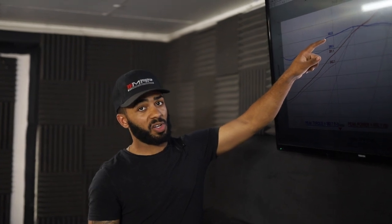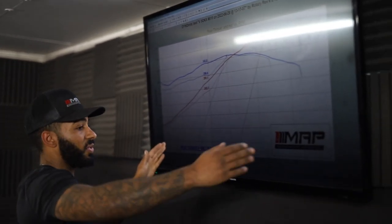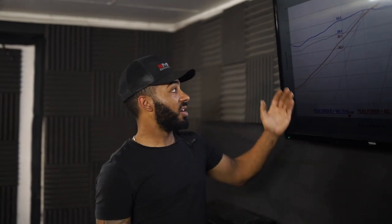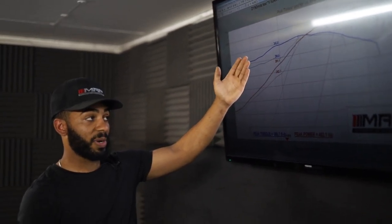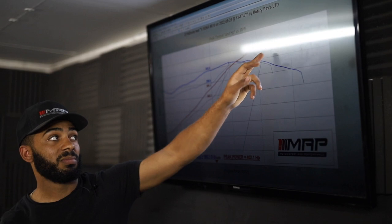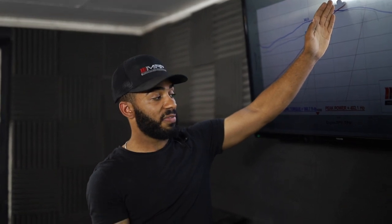That is a lot more torque and you're going to feel it. When you're driving your car you're not really using 6,000 to 8,000 RPM unless you're driving flat out, which 75% of the time you're not. So you want to feel the torque from 2,000 to 5,000 RPM — we gained 50 foot-pounds in that mid-range, which is crazy for a naturally aspirated car. We've gained a little on wheel horsepower — five or six — and peak torque stays the same, but this mid-range improvement is what you feel. Torque is what gets you down the road, and having peak torque at five and a half thousand with nothing before it just makes the car feel laggy, like an old Japanese car with a big turbo.